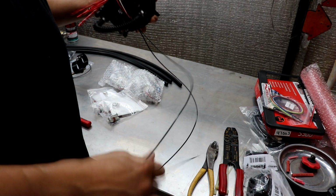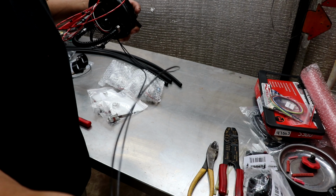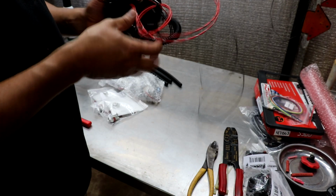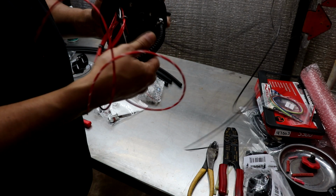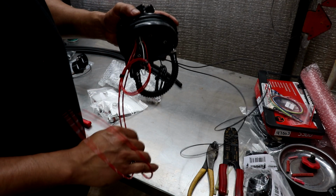so you see there, getting ready for the crimping tool. I've also done the 2 ground wires for the pumps. Sorry, I stripped both of those 1/4 inch. So you see here, I wound up the excess wire. I don't want to cut it because you never know down the road. They might come out with a different hanger for 3 pumps and you might need it.